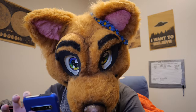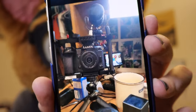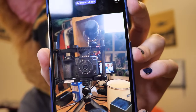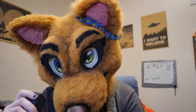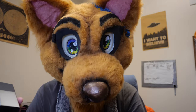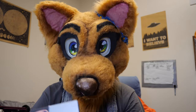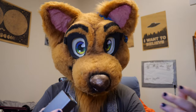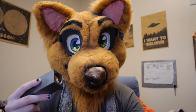In fact, my phone here has this exact feature and it has no light field technology involved. I just took a picture of my camera and it has this really cool 3D effect — it's actually pretty effective. The saving grace of this camera is that it is actually capturing different perspectives, but my assumption is either Lytro didn't know a way to apply those perspectives effectively, or the perspective change is so subtle that it wouldn't make a visible difference.